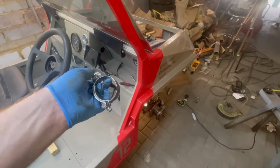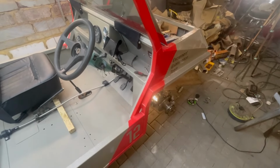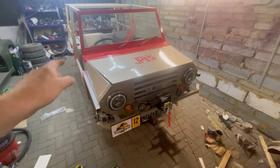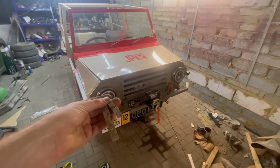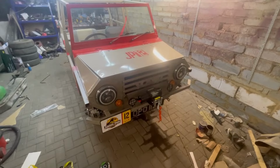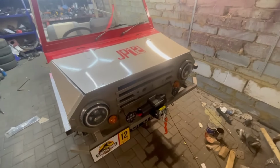Not that we're going to drive very far. And now I've got some of these stainless steel clamps to go on the exhaust, so get under the car and do that. Okay, getting near the end of this session. I've tied up all the front, the wiring's done on the front there. I've tied it up and clipped the wires. I basically made some little aluminium brackets, drilled and tapped the frame, just to make little clips to hold the loom. We'll see how that does.